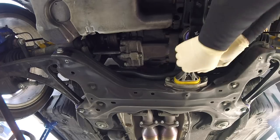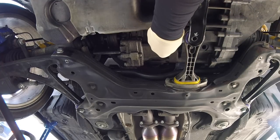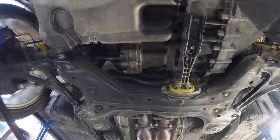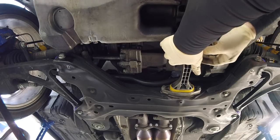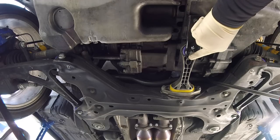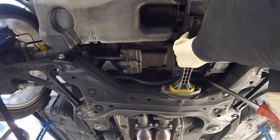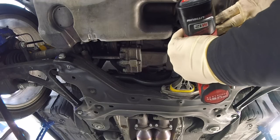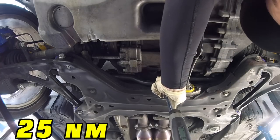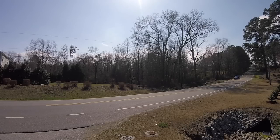When we move to the car, I like to start with the bolts at the back of the dog bone that go into the subframe — go ahead and get those snugged down. The instructions do call for installing a washer on the top side of the dog bone between the mount and the transmission, but to me the bolt felt a little too short for that, so I left it out. When installing the bolts for the transmission, you may need a pry bar to persuade the engine back and forth in order to get both bolts lined up. I like to start with the longer bolt — the one that goes through the bushing — then put the shorter one in. Go ahead and snug them down, then torque all bolts: the bolts that go into the subframe are torqued to 25 newton meters, and the bolts that go into the transmission are torqued to 50 newton meters. After that, put the belly pan back on if you had one, and now it's time to take her for a drive.